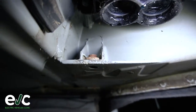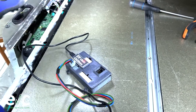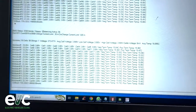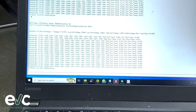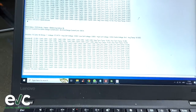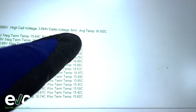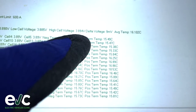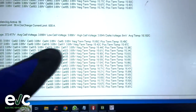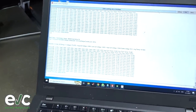Testing the complete battery pack on the bench without putting it on the car, we connect directly to all 16 BNBs with our tool. We can see all 16 blocks, meaning everything is okay — if even one BNB were disconnected, we would have no communication with the battery pack. The delta is 8 millivolts, which is almost perfect; the maximum allowed at this state of charge is about 45 millivolts. Total battery pack voltage is 373V. The complete BMS state is happy and balancing all 96 bricks — our job is done and now we assemble it.